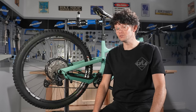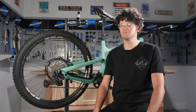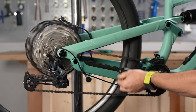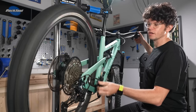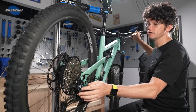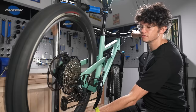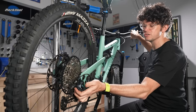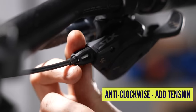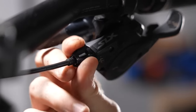With the cable tension now set, we're just making small adjustments. We should only need to shift between two cogs just to be able to see if the index isn't working. So turn the cranks, click up a single gear and see how the shifting is. It's jumped up two gears and I only clicked once, so that means the rear mech is pulling too many cogs — we need to back off the tension. It's very reluctant to shift back down to the smaller sprocket, which again means the mech has got too much tension on it. Turning the barrel adjuster clockwise into the shifter is going to release tension; turning it out anti-clockwise is going to add more tension. So we'll release the tension by screwing the barrel adjuster clockwise into the shifter.